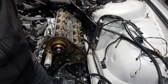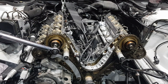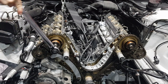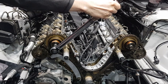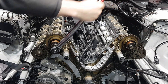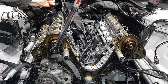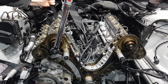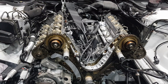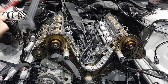I'm gonna do the other side now. I've preloaded this again to 110 Newton meters. My torque wrench is in place - I'm gonna hold the camshaft. The blocks are helping; the chain is obviously taking some of the pressure, and the crankshaft is pinned as well. That's 110. Now 125. That's 125.